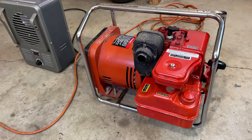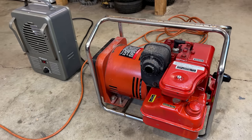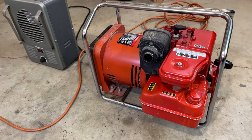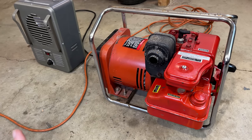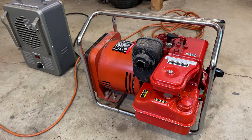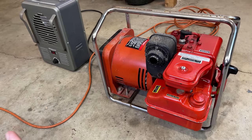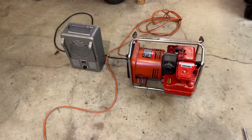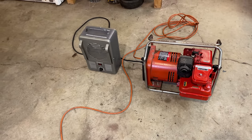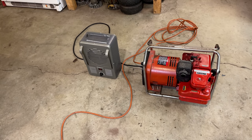And it's kind of surprising, actually, that the voltage was so high, given the fact that the capacitor in there most likely is from 1985. So I would say it is still running very well. And most likely, I'm going to bring the loaded engine speed down to 58 hertz, which will just help the voltage situation a bit. But yeah, all things considered, this is doing a very good job. I think I'm going to start it again real quick, apply that 750 watt load, and bring the engine speed down to 58 hertz under that load, and then take the load off and see what the voltage does.